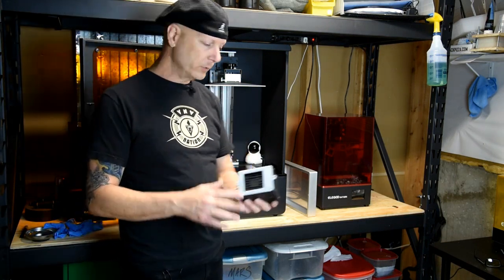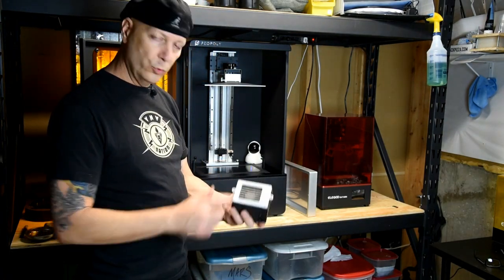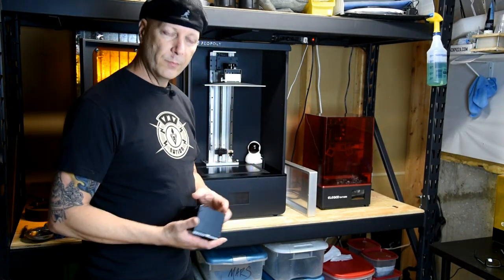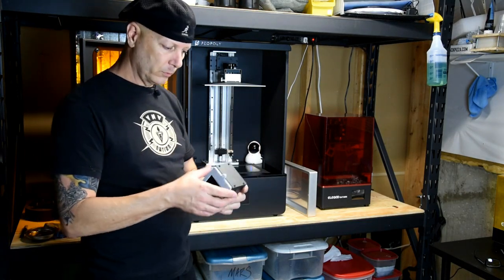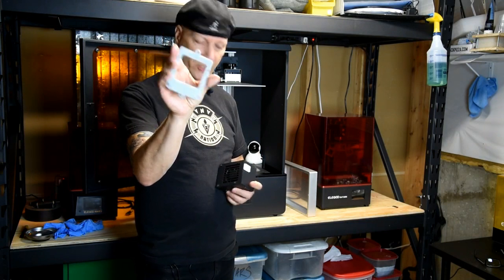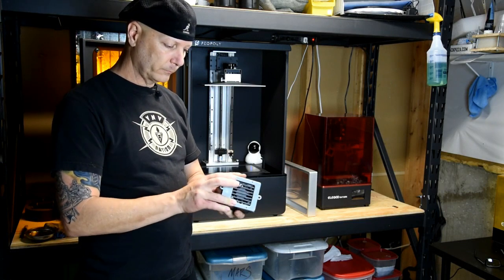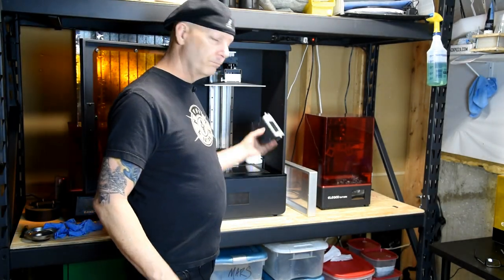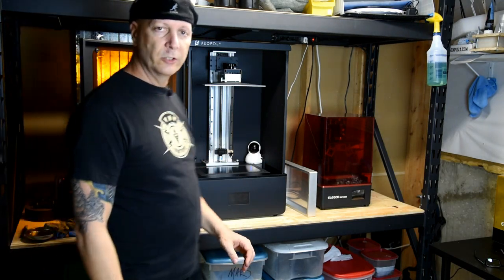And then I went ahead and I just printed this part, so that way when it's up against here, these passageways work. And then there's 2 mounting screws here. If you're not comfortable drilling into the side of your Phenom or whatever it is that you're going to use this on, you could just use double-sided tape and just put it on there. How is this being held on? There's 4 counterbores on this side because you've got 4 protruding Allen heads right here, and it just mounts right in there. And there's no need to screw it on or anything because this is going to hold it. You could glue it, whatever you wish. Totally up to you. But I went ahead and I picked it up, and I will leave links down in the description for that as well.